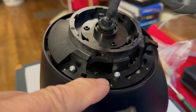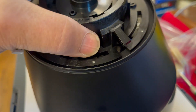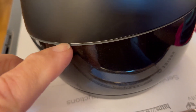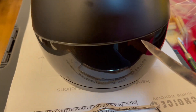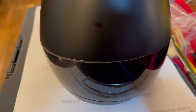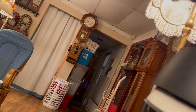These screws are at an angle. Once you remove this head and unplug it, you might think this thing should just pop right off — but no, underneath there is double-sided sticky tape. You'll have to take a knife and go underneath here carefully, because the black plastic shrouds are very fragile. Then turn it and slide it to separate the sticky tape from the outer part.